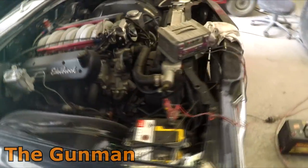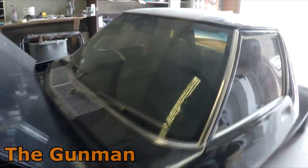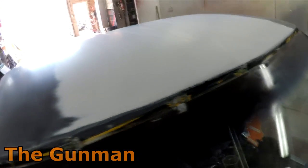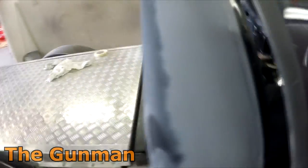There was bubbling paint in one of the channels, so we ground it all right back, put a bit more filler in, put it back in the booth, primed it up, and continued on with prep work. The battery kept going flat on this car and we were pushing it around a lot, which is a bit of a pain. I did rub through a little bit so I put a bit of 1K primer there. I was using the Nason 1K acrylic primer and I've got nothing but good words to say about it — it's compatible with the two-pack base coat and you don't get any shrink back or fry-ups.